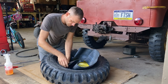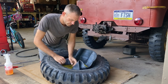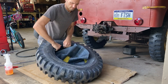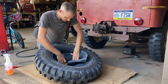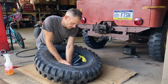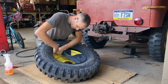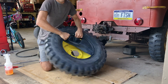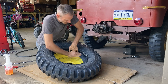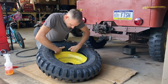Start feeding your tube into the rim. Make sure you don't snag it or twist it on anything. Don't use any tools for this — just rotate it. If you hold it up here with your legs it creates a little bit of a gap. Some people put a little air in their tubes before they do this. I don't. I found it just makes it harder to work with because it makes it a lot thicker even when you take the air back out. You do kind of have to stretch it over the rim.